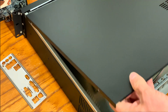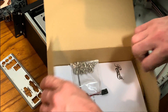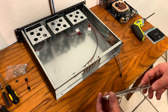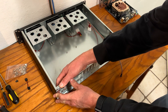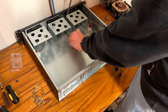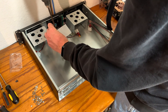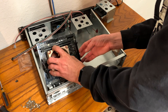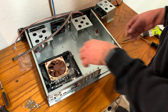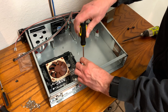It's time to prepare the case itself — remove the screws, open it up, and locate the hardware kit inside. While you're in there, it's time to install the motherboard back panel; this is very important and some people always forget this. Now I'm removing the center hard drive caddy so I can install the solid state drive on its tray adapter in that location. This case has mounting posts already installed which perfectly match this motherboard, so I did not need to add any additional. Now I'm going to secure the motherboard to the case.